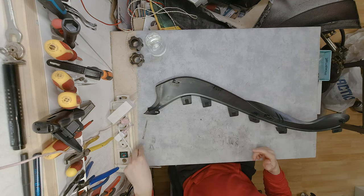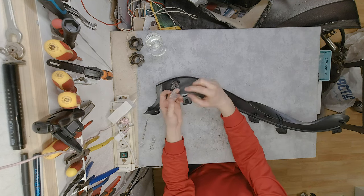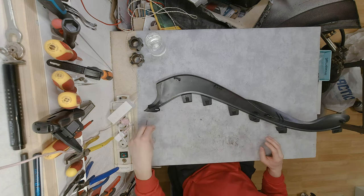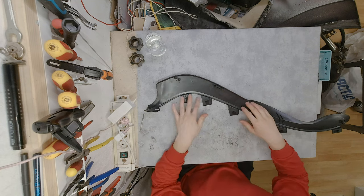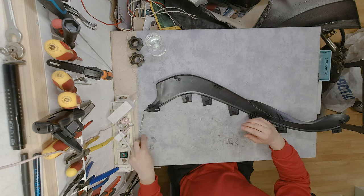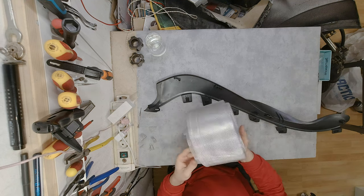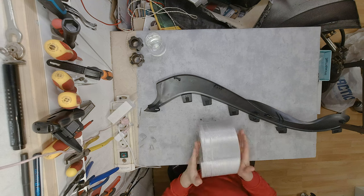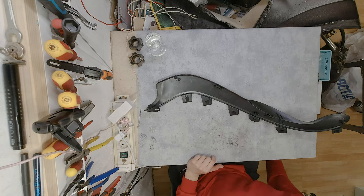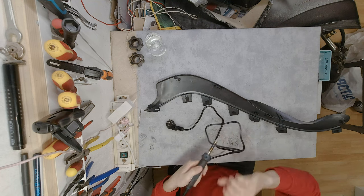Anyways, basically just like any other repair that I did, we are going to use a soldering iron and this aluminium mesh just to strengthen these pieces of plastic so they are never going to break. And therefore, we are going to prevent this happening ever. And this only costs a couple of euros for a whole bunch of that, used in a roofing section of Bauhaus in my case, or Home Depot, or B&Q, whatever.